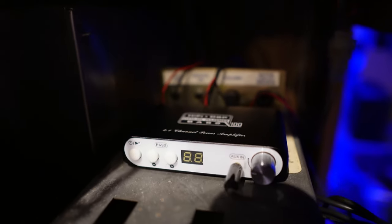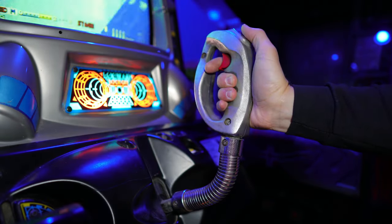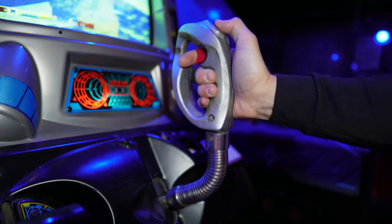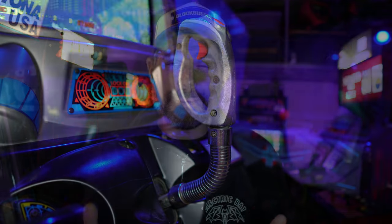The other problem is the audio amp is actually busted — the right channel is broken. I have a temporary solution for now, and my thought would be to rebuild the audio amp. But there's something cool I think I could do with that rumble motor: what if I took the rumble motor, left it there, but took the fuse out so it was no longer working, and tried to achieve a similar effect with a bass shaker right where that rumble motor would be? So that when you crash, get shot out of the sky, or shoot a missile — all things that trigger the rumble motor — it would engage the bass shaker instead.